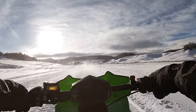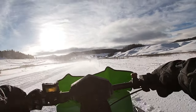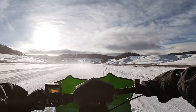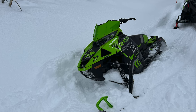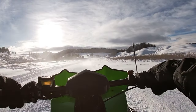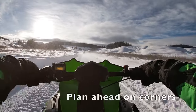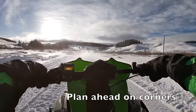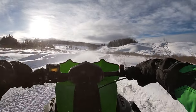In my opinion, the Riot 9000 is a trail sled that offers much better traction than the Thundercat, either on hard pack or loose snow trail conditions. Because of the added track length, you get much better traction, but you also sacrifice a little bit in the corners. The Thundercat will go around a corner without too much trouble, but in the Riot 9000 you have to think ahead a little bit. The Riot 9000 is better for wider, straighter trails and lakes.